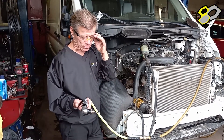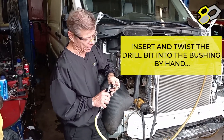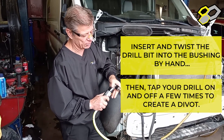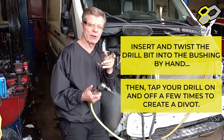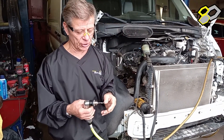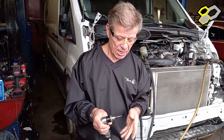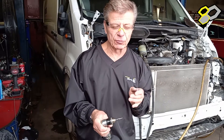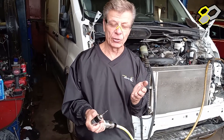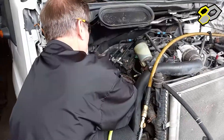I'm going to show you — we go ahead and put the bit in the drill, pushing by hand so we don't damage the bit, and then we tap it a couple, three or four times just to create a divot. That divot is going to help us keep the bit from walking off center and make sure we're straight. It's also going to allow us to engage the full cutting edge, which is really essential. These bits will cut up to Rockwell 90, which is very hard material, but if you're not using the full cutting edge you can diminish that cutting ability.